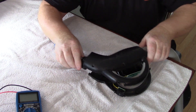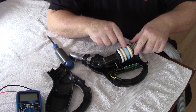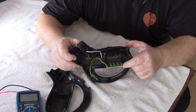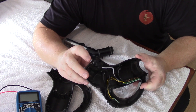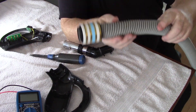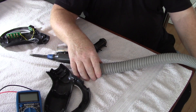This is what it looks like inside. It has four rings, and these are your contacts. One contact is for this circuit board, which hooks over to the switch and your power inlet for the handle. That's your beater bar power right here — it goes into the handle of the beater bar. We're going to test these rings: two of them will be high voltage and two will be low voltage.